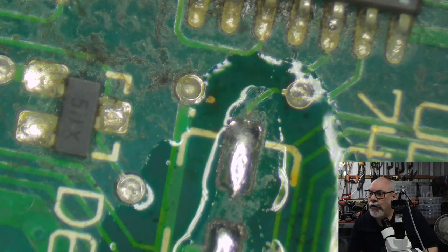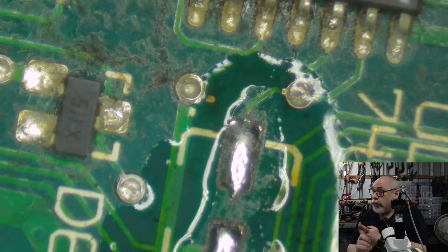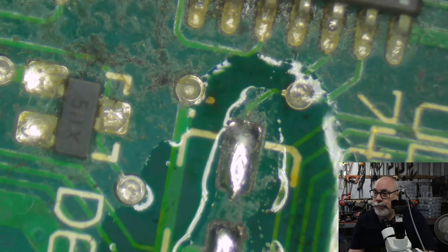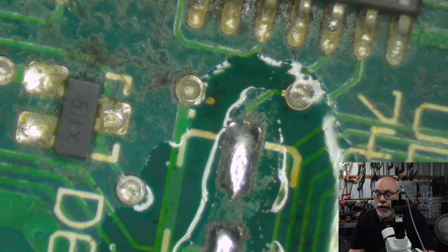Sound is coming out of the headset port if I plug in external speakers. That tells me that you've probably got an issue with, well, it could be the speaker, of course, but it's probably on the analog board, because I'm pretty sure the amplifier for the sound is on the analog board of the Color Classic. So you are probably going to need to recap the analog board and have a look at that. There are a few videos on my channel for that, removing the analog board and recapping it. So just keep that in mind.